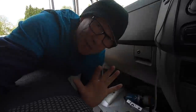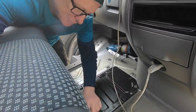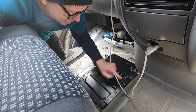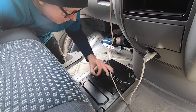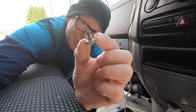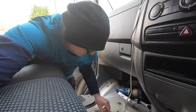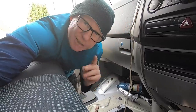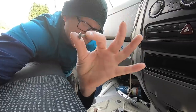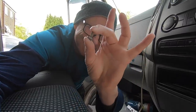Whilst I'm here with my battery lid exposed, I want to share a comment. The Irish Rover had trouble with his battery - he couldn't get to it because the bolts had seized up and he had to drill all four of them out. So I suggest if you've got a battery tray like this in your van, whether it be a Mercedes, a Crafter or a Vauxhall, put a little bit of lubricant on these bolts - look how rusty they get. I'm going to put a little bit of copper slip on these bolts before I put this all back together. Thank you Irish Rover - make sure you lubricate these little bolts, because the last thing you want is to be stuck somewhere and unable to get to your battery because they've seized.